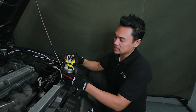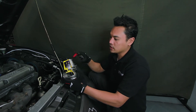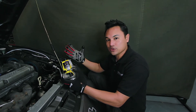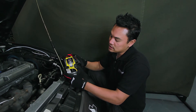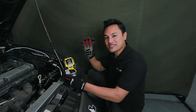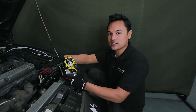The Synapse wastegate is different in that it doesn't have a diaphragm, but you can also treat it like your traditional wastegate. You choose a port on the bottom to open it and a port on the top to close it, and you can use it with any other boost controller you'd use with a normal wastegate. But what we've done differently is this design can actually change your boost pressure for up to six different settings without ever having to buy a boost controller — and that's what we're going to show you on this engine.